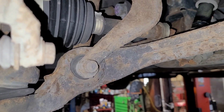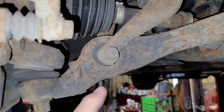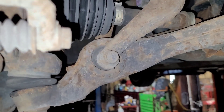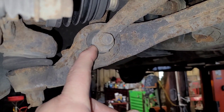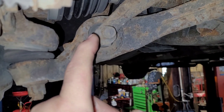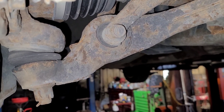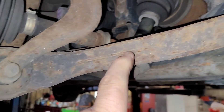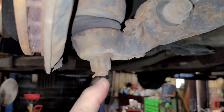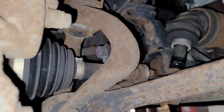So what am I going to do? I don't even know at this point. I'm going to start taking stuff apart and see how it goes. First off you got to take the axle nut off and then we're going to try to get that clevis — that wishbone, whatever you want to call it — get that bolt out. That bushing's got a steel sleeve in it. This bolt has a tendency to rot into that sleeve and when they do they don't want to come apart — they become a hassle. I got a funny feeling this was an up-north vehicle at some point, just judging by the rust on it. All right, let me get my tripod and let's get going.